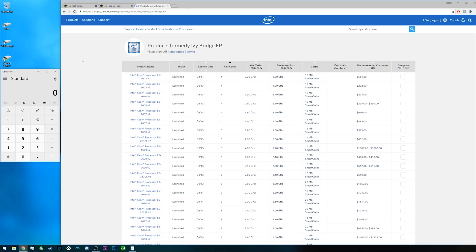Now we've moved over to the Intel product page for Xeon processors of the Ivy Bridge generation, sorted by core count. The processor we're targeting is the E5-1650 v2 for a couple of reasons. The biggest one is cost — right now on secondhand sites like eBay they're quite cheap, especially considering you're getting six cores and 12 threads. Another good part is that it's an unlocked processor.